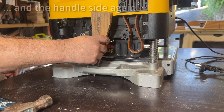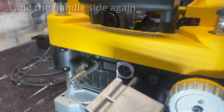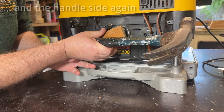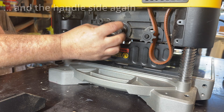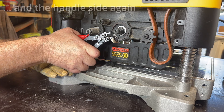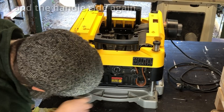The main problem is that you need to support it from the inside until the small bearing at the far end gets seated. I resorted to using a mallet and that worked quite well. Leaving that snap ring in is a good idea on the far side because you can see exactly how far it needs to go before you stop - you don't want to bash it into the ring on the far side. The new cutter head is installed.